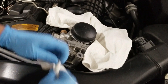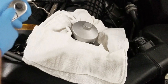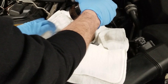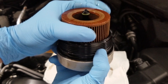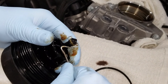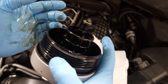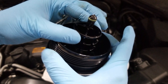Now I need to remove the old oil filter housing cap and try to get as much oil out of it as possible. Once you have the oil filter and cap out, remove the oil filter like you normally would. Next, remove the gasket that's on top of the cage and put the new one on. Now here comes the delicate part — I tried using the oil filter to wiggle the birdcage loose, but I couldn't really get it to come off.